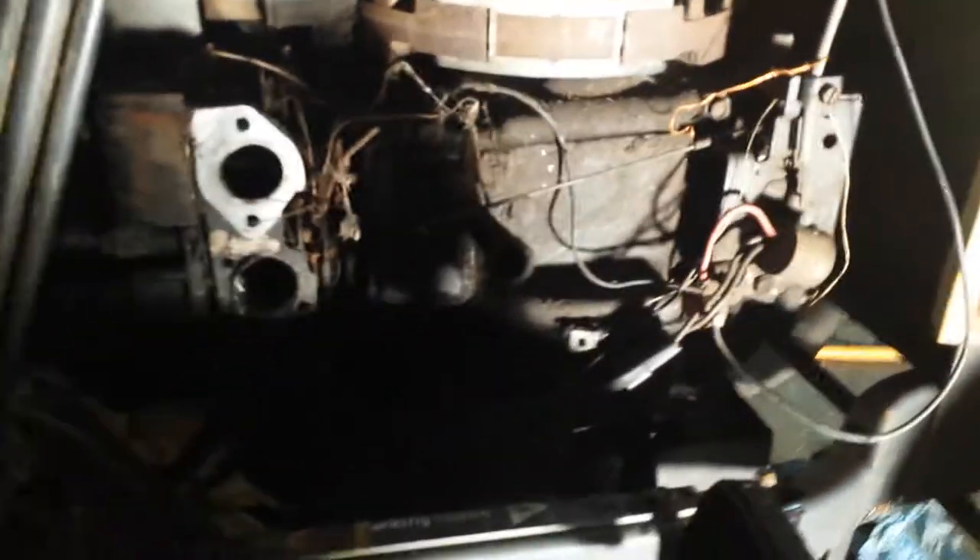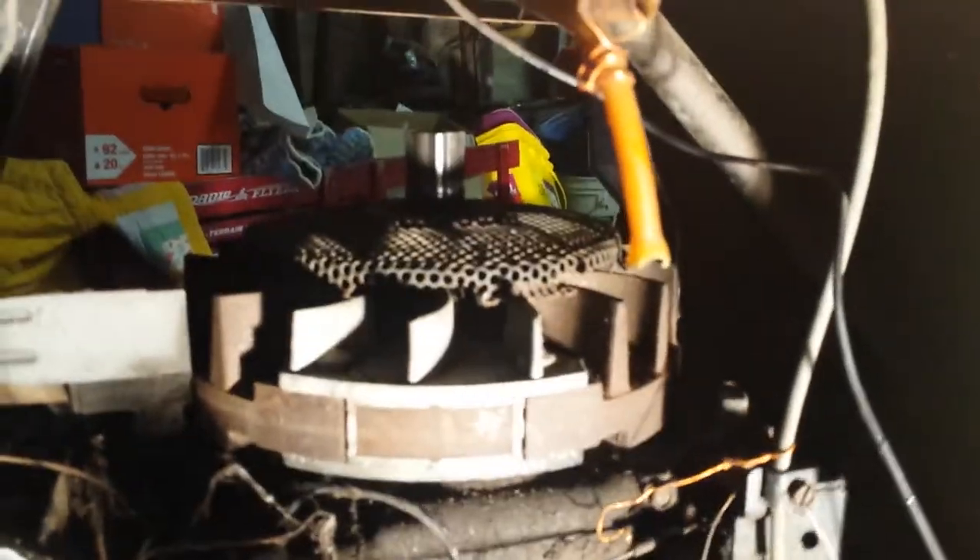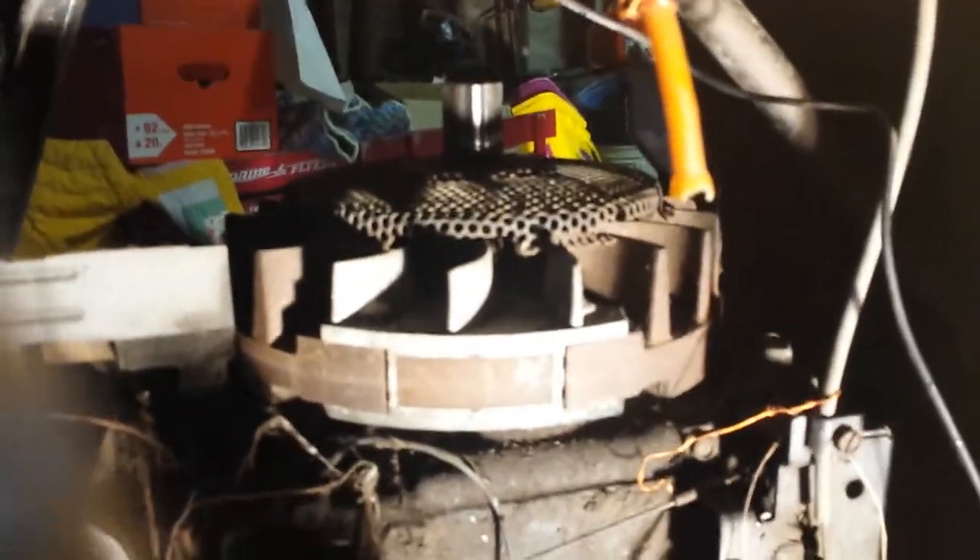My deduction is this motor is not seized. I thought it was seized, but it is not. What I found out is there's a little sprocket on top — this piece slots into the shroud and that's the mechanism for the recoil starter. On this one, that's what seized. The thing is stuck like chuck.